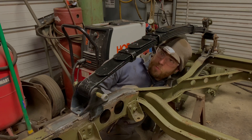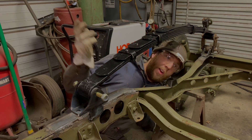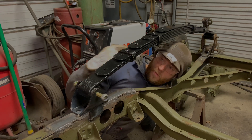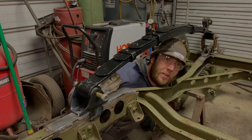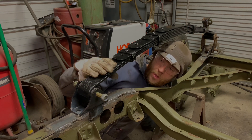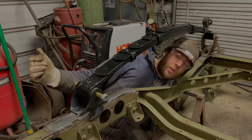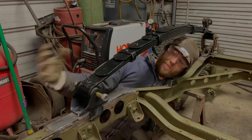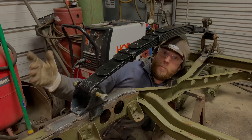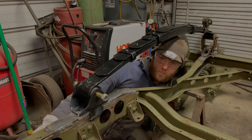I got this spring completely set up, facing the right way. The YJ spring center is the same left to right from center — I think it's like 25.5 and 24.5 inches — so it's right in the middle. I'm using all rear springs. I'm going to go ahead and weld this one in, and that'll pretty much be it for the rear springs. Then I've got to do the front, which is where all the magic is — steering linkage, steering box, shackles, and mounts.